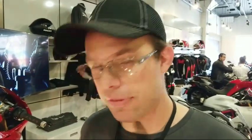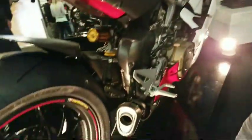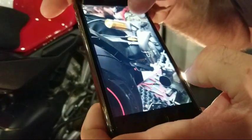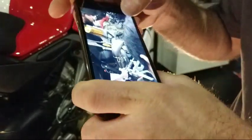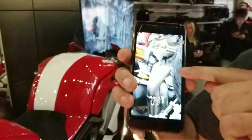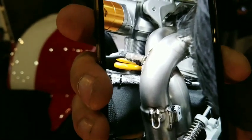We put the Akrapovic on Thursday morning. Each pipe is connected to one cylinder head — they're not connected whatsoever. That's how you get that crazy increase of power from the regular version to the Speciale — basically 12 horsepower, from 214 to 226. Can you explain to our audience what he just told you about the exhaust? We're removing the butterfly valve, which removes the restriction, and they're separating all the exhaust. They cross over — one pipe is pumping both of its cylinders. So there's still only two pipes for the V4, and it literally has eight exhaust valves feeding out of one pipe.